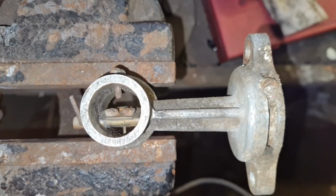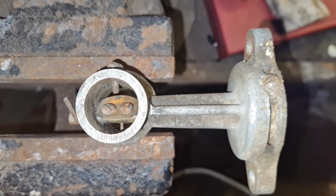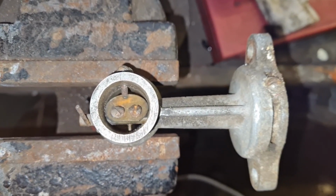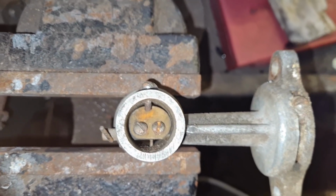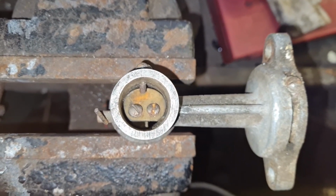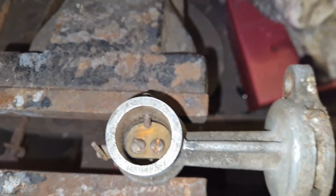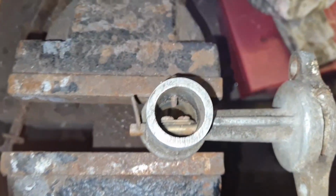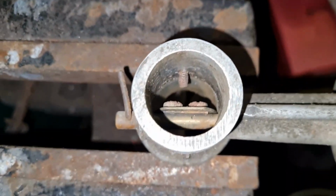Yep, here it comes, look. That choke is opening and closing. That is absolutely brilliant. Absolutely brilliant. Look at that. Right, let's put some heat on again. I'm just heating that spring at the end, gently. There you go, look at that choke. Well, that is super. That's how far I'm holding the heat gun, so I'm not blasting it. That should just simulate the temperature of the water as it warms up, and it is working, look.